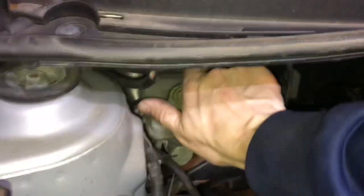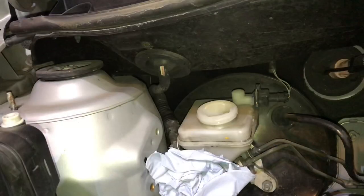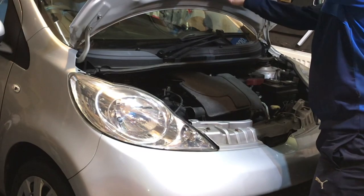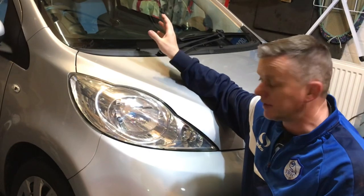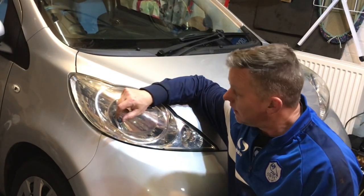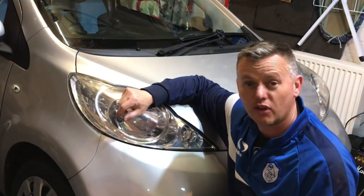Let's just check on the brake fluid — make sure it's up to the maximum. Just whip the cap off and have a look; we'll just need to top it up slightly. A bit of DOT 4 brake fluid going in — be really careful if you spill any and make sure you clean it up because it takes the paint off, it will just lift the paintwork. So there we have it: all done, new rear beam in, brake fluid topped up, brakes bled, everything's great. It's driving really straight. We'll get that wheel fixed and put back on to finish it off, but in the meantime it's fine to go. If that's been of any use and you've enjoyed it, drop me a thumbs up, like, subscribe — thanks for watching.